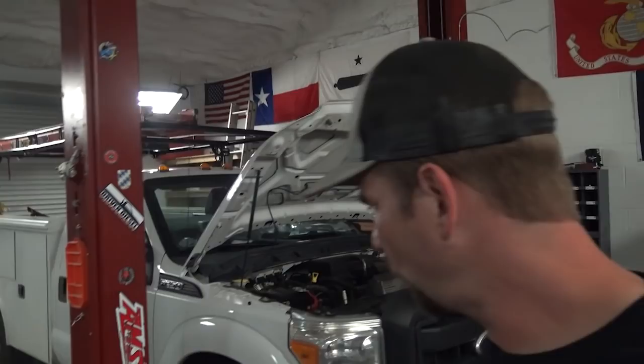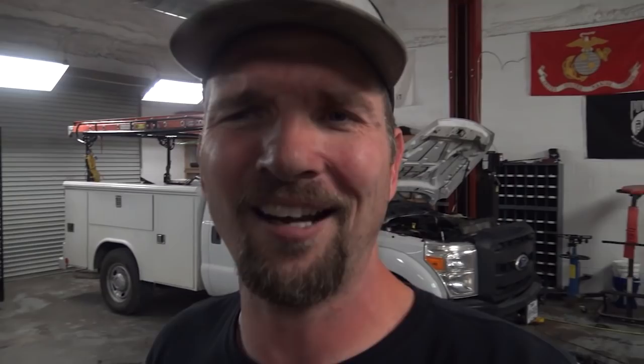Pretty quick and painless job. We did struggle a little bit on the front cab mount bolts because normally what happens is they actually smash themselves together - the lower mount and upper mount - because there's no bushing on the bottom anymore. It'll just sit there and vibrate and smash together, and a lot of times you have to actually cut those. We were able to pry them loose. Thanks to the Autel MS906BT we could program the keys. If you'd like to try or buy one, it'll be linked in the description - I've been using it about a year and it's worked fantastic. I've actually sold all my other automotive scan tools and just use the Autel now. I'm going to call the customer, go pick him up, bring him back. Hit the like button, hit the subscribe button, and if you've ever done cab mount bolts on these and have any tips on getting those stinking bolts out without using an impact, put it down in the comments. Thank you everybody - get out and fix something!